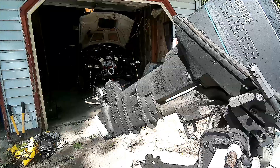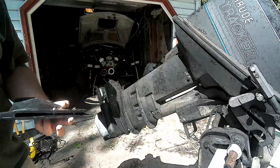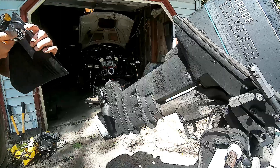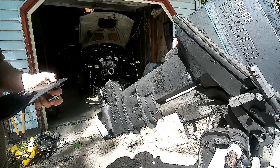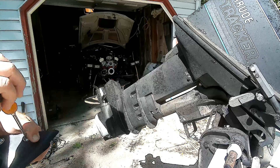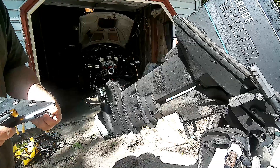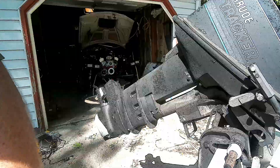We're going to try that hydrofoil on it. Hopefully that'll pick us up out of the water just a little bit more and give us that last bit we need to get on plane with this prop. If not, the only other thing I can think is to try a nine-pitch in aluminum — a little bit lighter. Kind of disappointed, but all we can do is keep trying. So we came back out to the house. We're going to throw the Aero Stingray hydrofoil back on here and see how it works out. Hopefully it'll pick it up a little, create a little less drag, and get us closer to the power band where we can actually get up in RPMs, because what we had going on was not ideal.